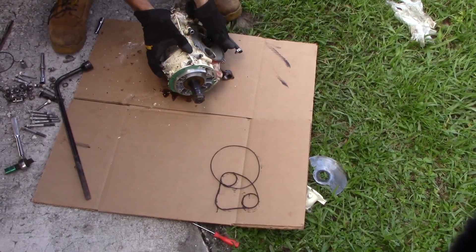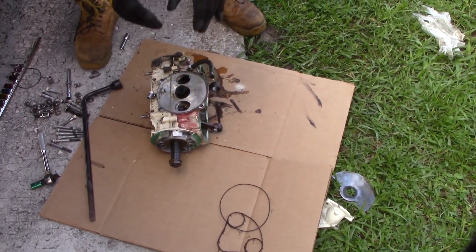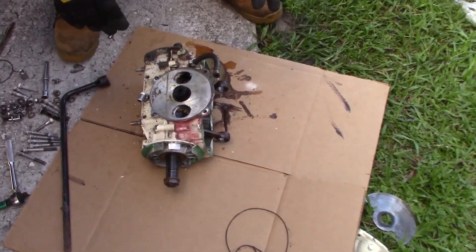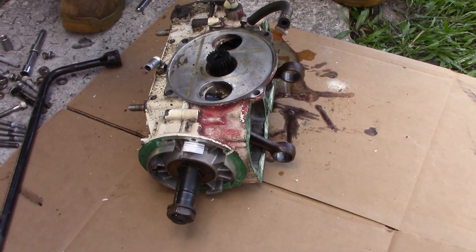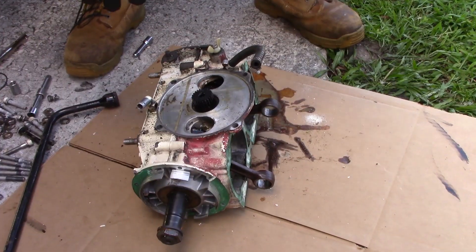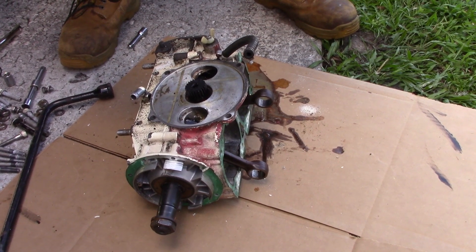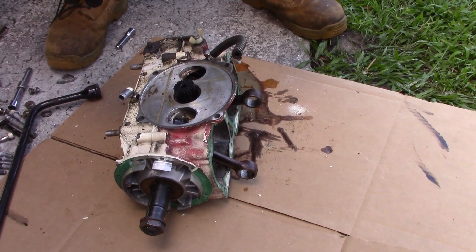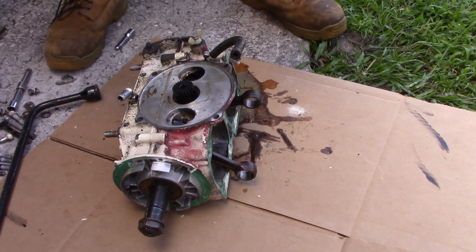So, working on this — it's the 657 that came out of the 95 GTX. The whole thing was I rode that a couple of times, didn't get a video of it. I've been away from videos for a while, but I rode this thing a couple of times and it ate about three quarts of oil, so I knew the inner seals and the crankshaft went out.